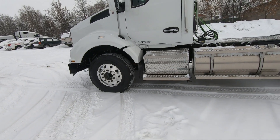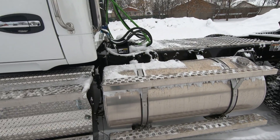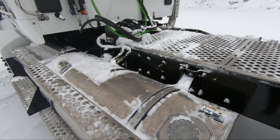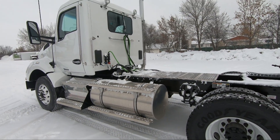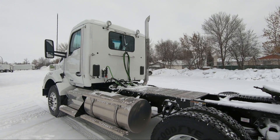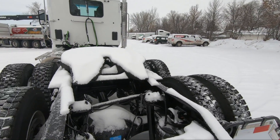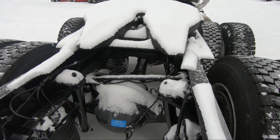As far as the batteries, they're right in this toolbox right here. We have your fuel tanks with the two-inch straps - these are unpolished tanks, so this is kind of the basic install. As far as the size, 110-gallon fuel tank on this side. If we are putting a wet kit on it, I would suggest doing an upright behind the cab - like a 50 or 75-gallon aluminum or steel tank. At the back here, we have a Holland fifth wheel. It's a 24-inch slider, 8-inch riser as far as the height.